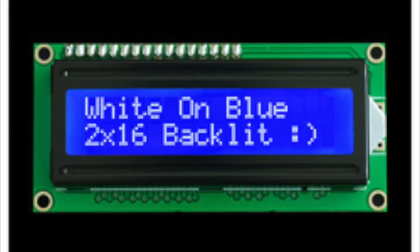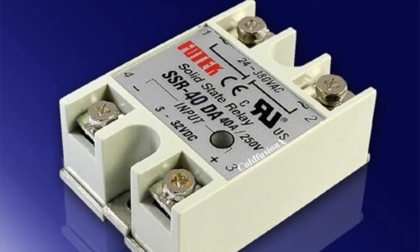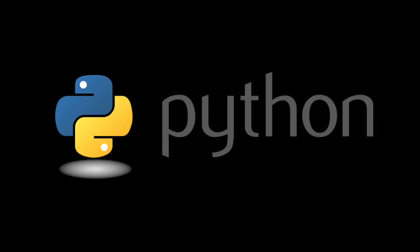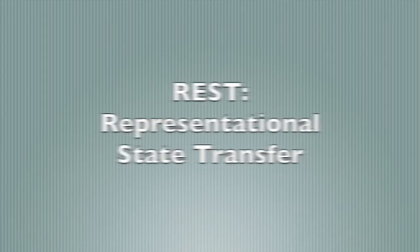The physical modification consists of mounting buttons and an LCD readout in addition to a temperature sensor, electronic relays, and a Raspberry Pi microcontroller embedded within the chassis. Along with custom Python code and a collection of Linux scripts, the coffee machine now responds to commands through a REST interface.